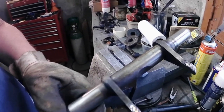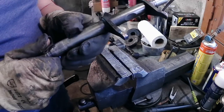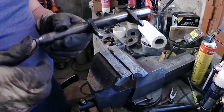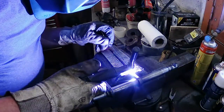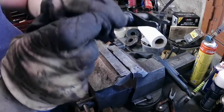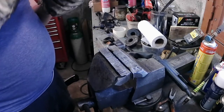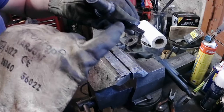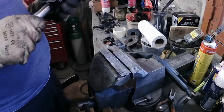There are some nice little welds there — not overheating the metal. Another bead there, a bit more on the edge as well. You can see the profile there starting to round up — it's going to be rounded and then it's going to be okay. I won't overdo it because we haven't heated very deeply into the metal, as you can see on the edge there.